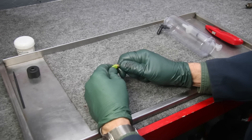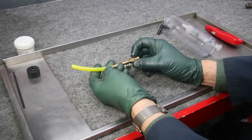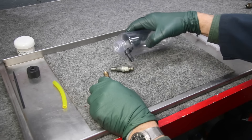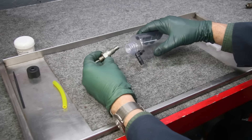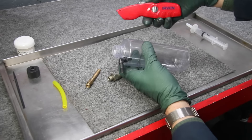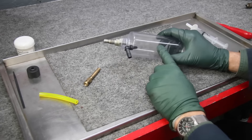The CIS injector is slightly smaller so it goes on a little bit easier, but you're still going to have to work the hose on, and as we learned in part one, once it's on you're going to have to clamp it down with a zip tie to keep it from blowing off when using the hand pump pressure tester. The thing I'm not happy about is on this fume capture bottle — the CIS injector goes right through and sits inside, but not so with the MFI injector. The fitting is too large; it'll just barely go inside the opening.